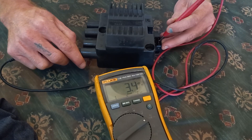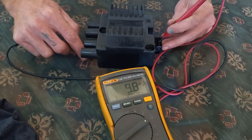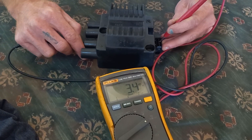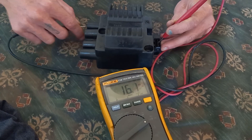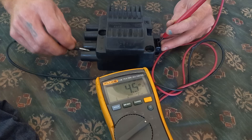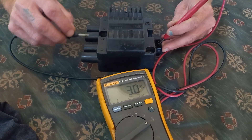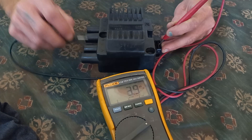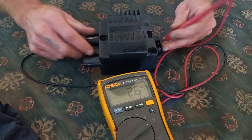The moment you touch it on the side where you plug in your plug wires, you're going to get that fluctuation as you touch it — that's the indication that this coil pack is still healthy. If you don't get a reading on each one of the places where a plug wire goes in, that's the indication that the secondary circuit has gone on the coil pack.